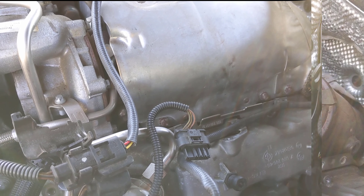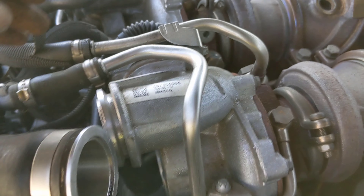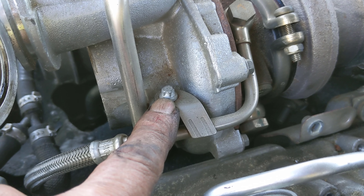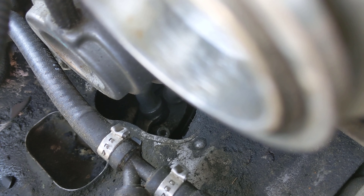With all that removed, we can see down in there — that's the famous plastic Y-fitting that everybody talks about failing. We're going to dig down a little deeper. We have a water inlet and outlet on the sides, and the oil inlet on top. Take those loose along with any bolts connecting them. Down inside you can see the oil return line, which is the one famous for getting clogged up, so we need to get down in there and take those bolts out.